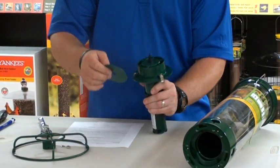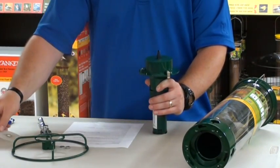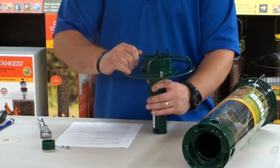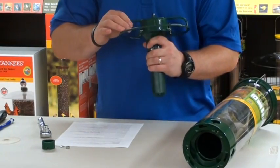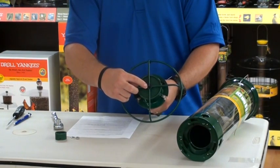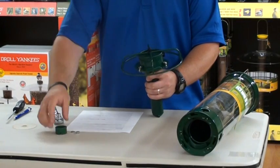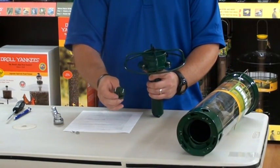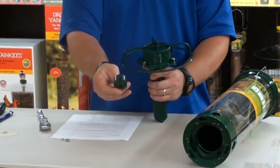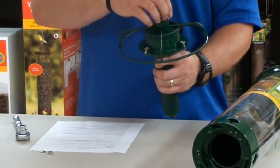Next you will add the friction disc, which again is either clear or green. Add your perch ring, and an easy way to get your perch ring on there perfectly with your hub is to take a flat side of the threaded end of the power stick and line it up with one of the spokes on the perch ring. Next do the same thing with the hub — the hub has a flat side on the inner circle. Put that over the threaded end and rest the slots from the hub on the four spokes.